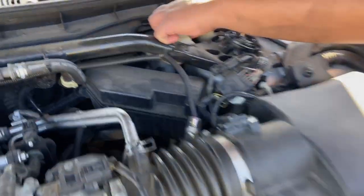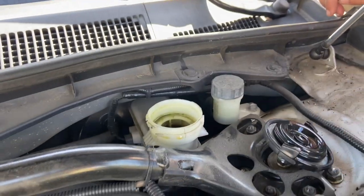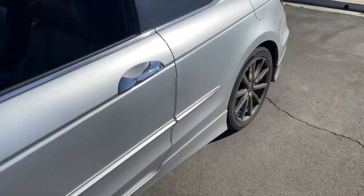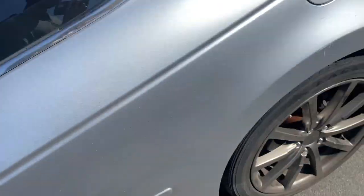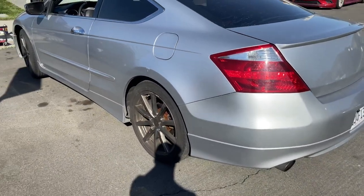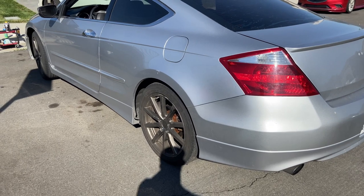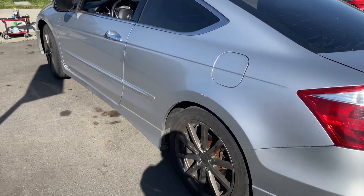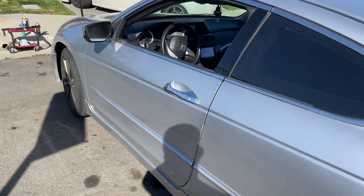Give it five good presses. For this brake fluid change we're using Bosch brake fluid, and this is the reservoir right here. We torqued down the wheels and lowered it from the jack stands. Going on a little test drive — even just pumping the brake it feels very different, it has a bigger bite, more aggressive.